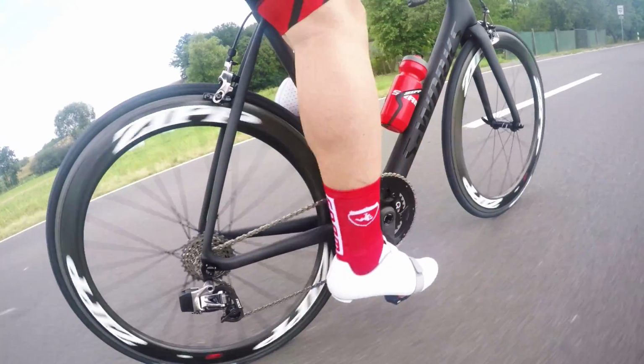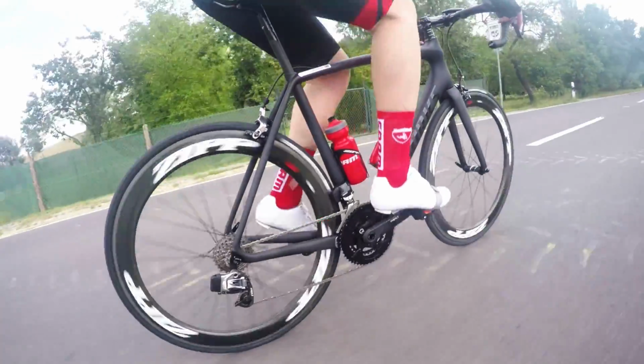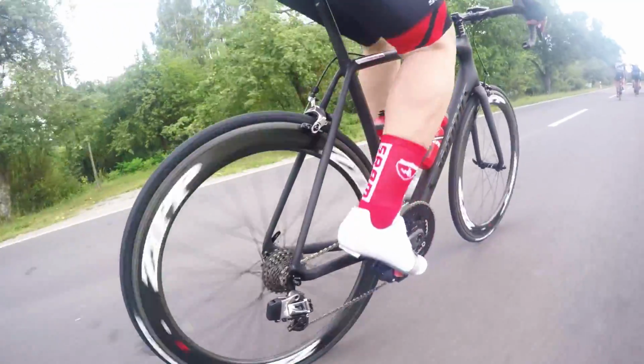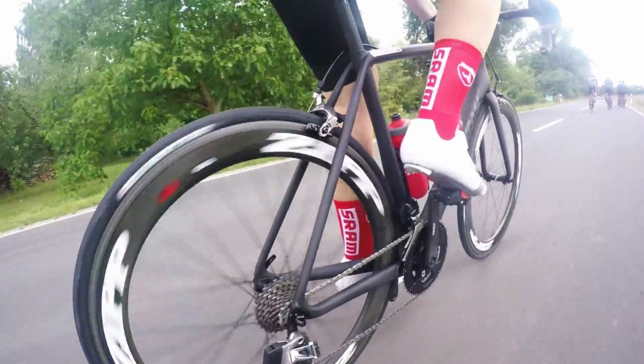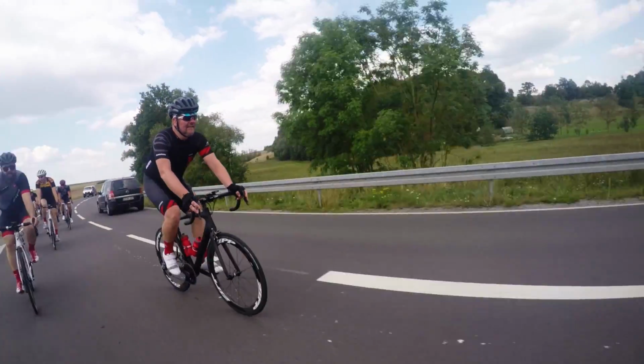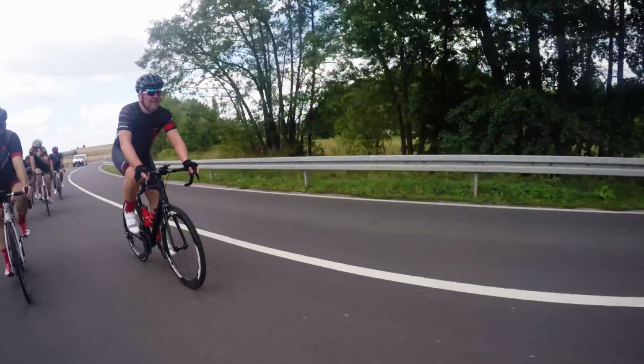The way that they've achieved this, compared to, say, Di2 or EPS, is that both Di2 and EPS are just live constantly. There's an accelerometer mounted in both mechs, and when you trigger it, it wakes up instantly, and then it shifts. That way, they're not wasting excess battery life by just keeping the system on. Inside the lever units, you've got CR2032 batteries, like watch batteries, the sort of things you'll find in backup lights. And again, they're claiming a significant runtime for those.